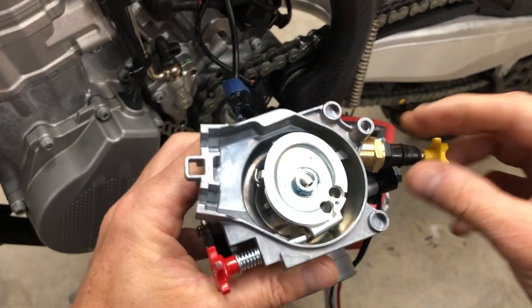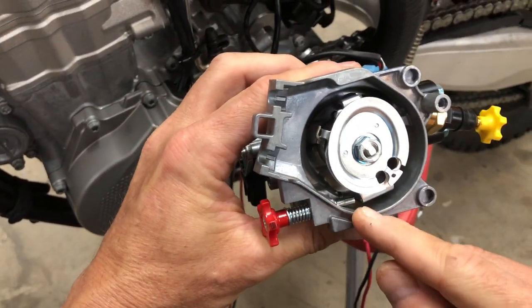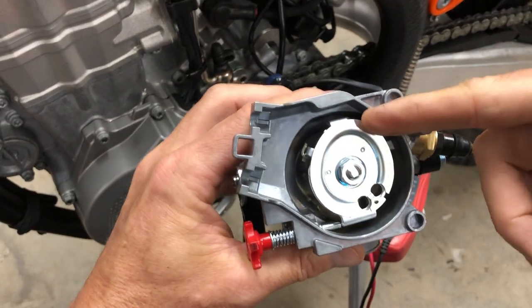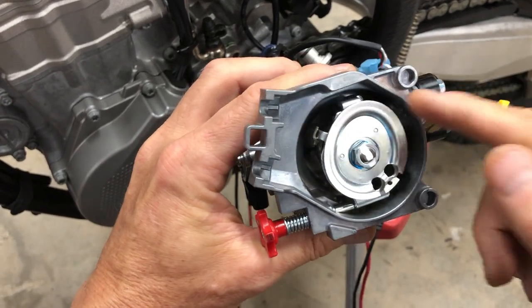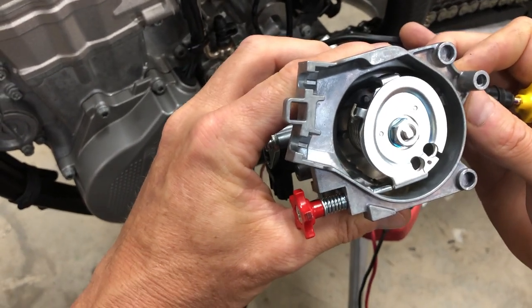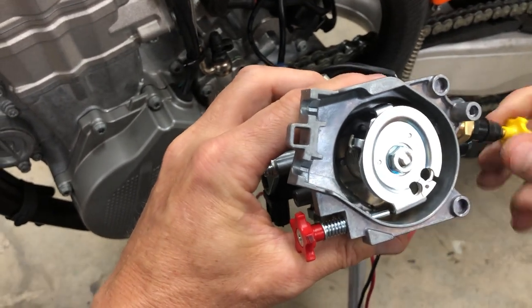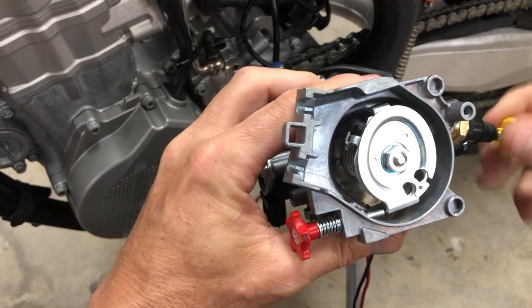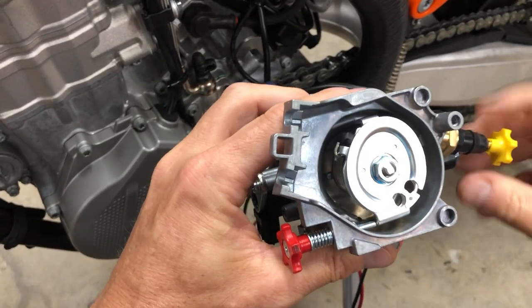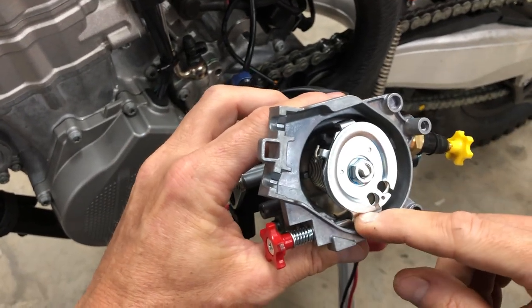Again, this is push in and pull out. And you can see here on the cam, notice that's our stopper here for our fast, that's our regular idle speed, and that's our stopper. And so when I release that pin, then it releases a little pin here on the cam that you can't see, that's buried down in there. But then it stops, it comes on and off at stop here, and that's when it's in the full fast idle position. And you can adjust this and notice how that gap goes away, and I can turn this all the way out so that in effect I'm on the stop and there is effectively no fast idle, and this knob will turn until it just quits. So that's the full out, and I'm off that completely.